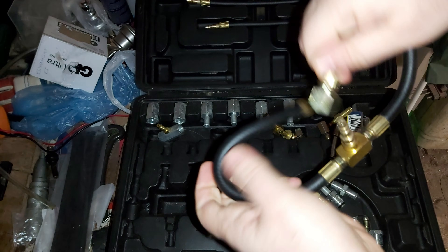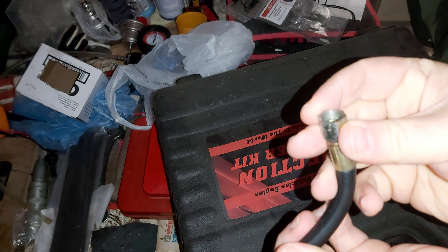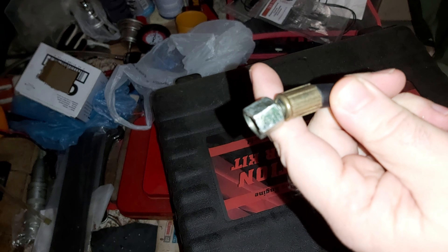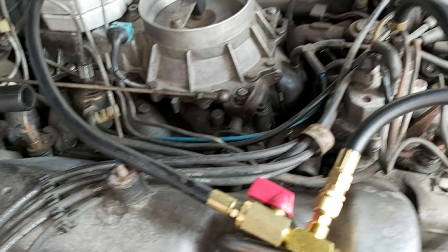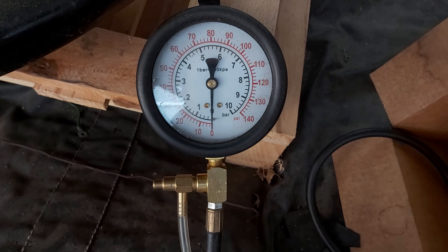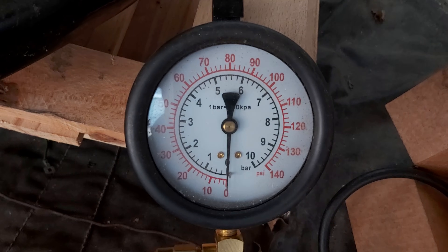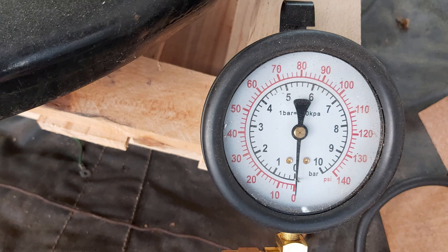The gauge itself is, in one word, crap. I had to make my own adapters, modify the hoses, replace sealing surfaces — otherwise fuel leaks everywhere. So measuring pressures on the system: one end here — oh, there are leaks. The only good thing about this gauge is the big scale, which is still very easy to read, marked in 0.2 bar increments. The readability is actually excellent.